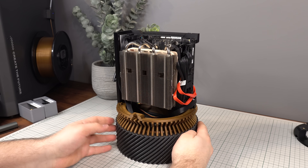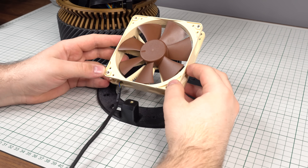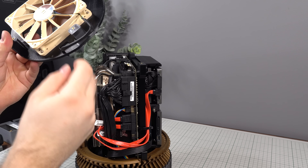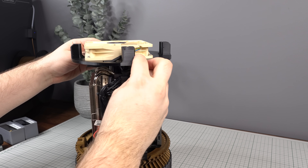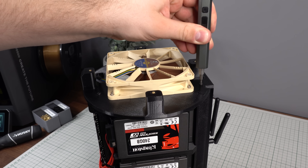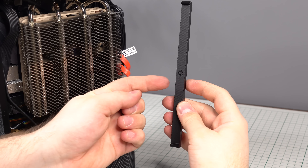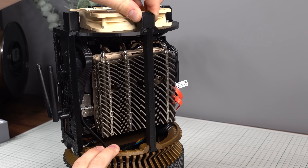The system is now functional, but a few parts remain. The top fan mount holds one 120mm fan, with the intake side facing down into the hole so air is pulled out through the top rather than pushed down into the case. The fan cable feeds through the hole in the mount and plugs into the fan header. The fan mount then secures with three M3 screws — two down into the motherboard mount and one into the rear I/O panel. A stabilizer bar in front of the CPU cooler pushes into slots in the top and middle sections and is kept in place by the external cover.